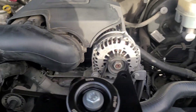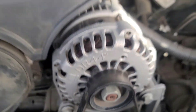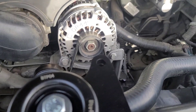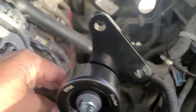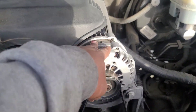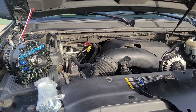So for right now I'm about to get it installed. Just got to take these three bolts off right here — one, two, three. It's a 15 millimeter. Take those off. I'm going to loosen the tension right now to pull the belt off so I can get to it. It's going to sit just like this, right underneath the stock alternator, and it's going to be on the side — put one on the top and one right here on the bottom. Eventually I might relocate the stock. I'm going to use the stock alternator for the truck, and the two Autotech 370s for my audio side, charging my lithium for the car audio.